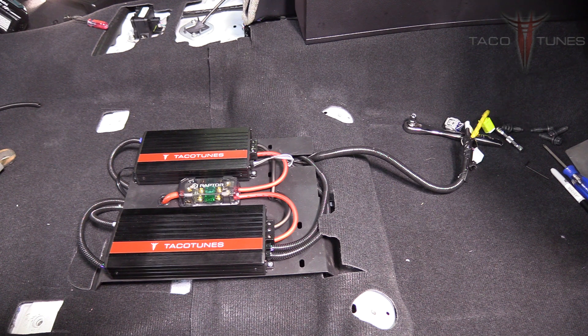A lot of guys think they can power their stock speakers — realistically some start with just a subwoofer setup and turn the input gain down on the four-channel amplifier so they don't overpower the stock speakers. We don't recommend that long-term because this is a lot more power than stock speakers are designed to handle. Check out our website for plug-and-play speaker options and aftermarket wiring harnesses that connect directly to your stock speaker wiring, as well as crossover mounts for door panels. The next video covers installing aftermarket speakers into the doors using this plug-and-play amp setup.